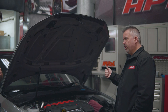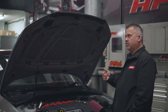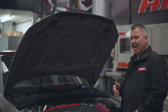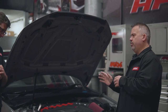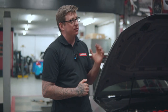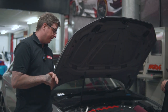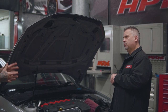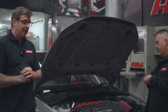Our TTRS on E85 had a few extra bits — we had the turndowns rather than downpipes — and that actually produced 734 horsepower on the dyno and 560 foot pounds of torque. The capability for torque is much higher, but we kept it lower for the sake of running on stock internals. We wanted to keep the internals inside the engine.